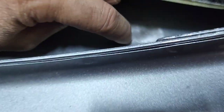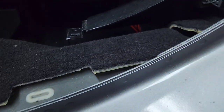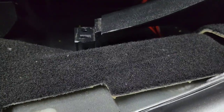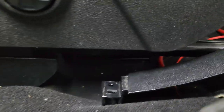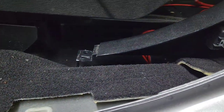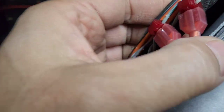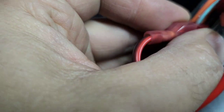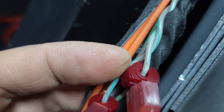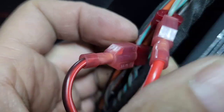As I mentioned earlier, I'm doing a small 800 watt amp — a Kicker 400.1, nothing big. I'm only doing one woofer, so I'm going to ground it right here using two self-tapper screws. For the speaker wire colors: light green with gray is positive, and dark green with gray is negative. I'm running the ground over inside there.